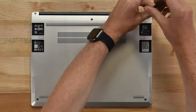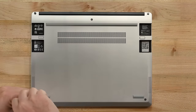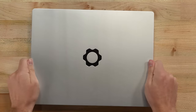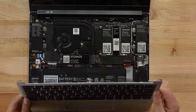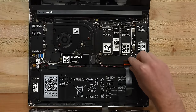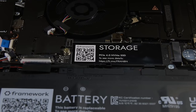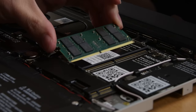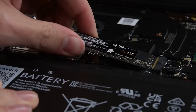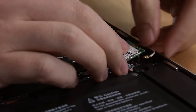To get inside the laptop and install these parts, I just need to twirl 5 Torx screws on the lower case. These are captive screws so they don't fall out and get lost, which I love. Then I'll flip the laptop over and lift up the keyboard assembly, which is held in place with magnets just like the newer Surface Pro laptops. Underneath the keyboard is pure beauty — every major component is labeled and there's even a QR code which will take you right to the spare part page on Framework's marketplace. The two 8GB sticks of RAM slide into their homes, along with the storage drive and the WiFi card, after some coaxing of the pesky antenna cables.